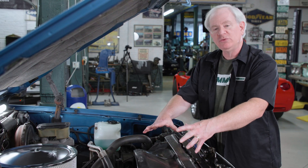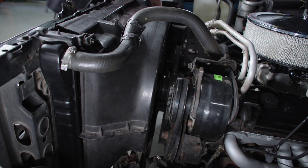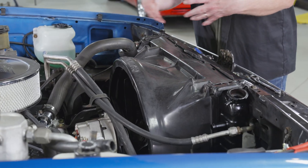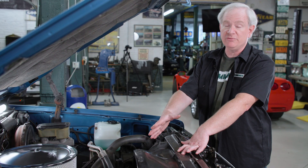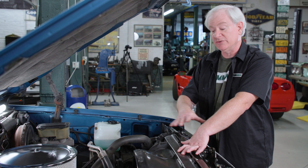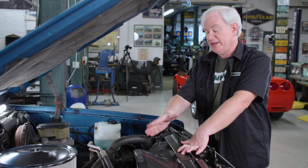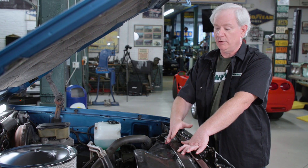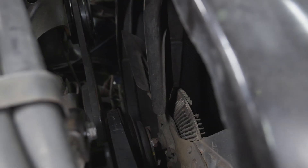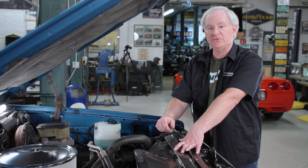Our Chevy truck's got a nice big full-size fan shroud on it. Fan shrouds are really important — they help direct the air that the fan is pulling over the radiator core, and usually the factory ones cover the entire core. Now, if you go back into the 70s and 60s, a lot of times cars that did not have air conditioning did not come with a fan shroud. But if you've got a modern hot rod — even if it's a car from the 50s — if you've put a hotter engine in it and you're having cooling issues and you don't have a shroud, you should probably get one. If one's not available for your car, they're not that hard to make. Our air-conditioned truck has a clutch fan — if you're running a clutch fan, make sure your clutch is in good shape. They do wear out and when they start to slip, that's another thing that can cause cooling issues.